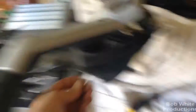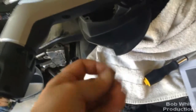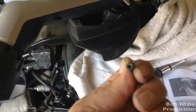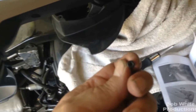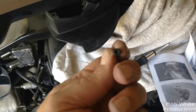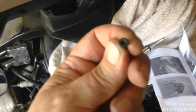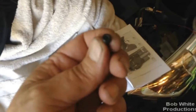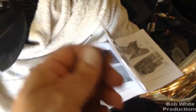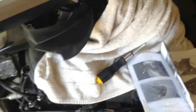Getting there — the next step from the manual says to remove these bottom screws to take off these black plastic covers. Now they are Allen type, not Torx. I don't have a whole bunch of Allen bits, but I did find that a Torx would fit and they're not that tight. They want you to bin these — the kit will come with replacements. There are four on each side, so eight total.